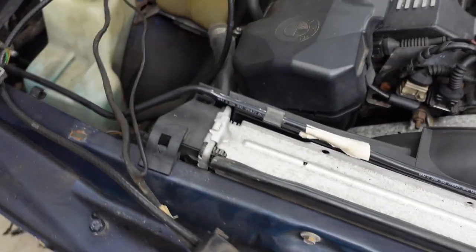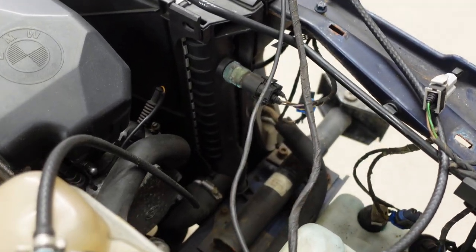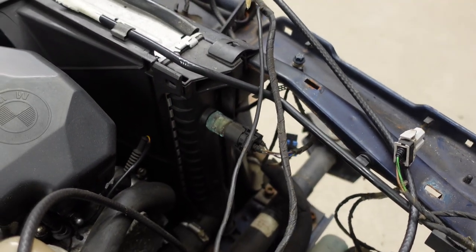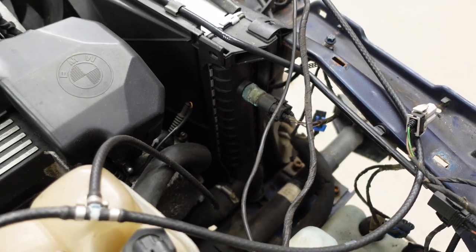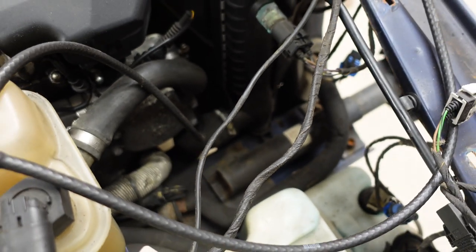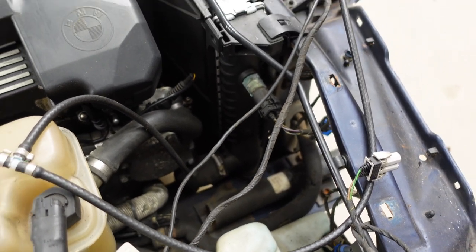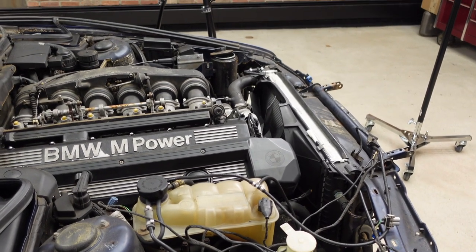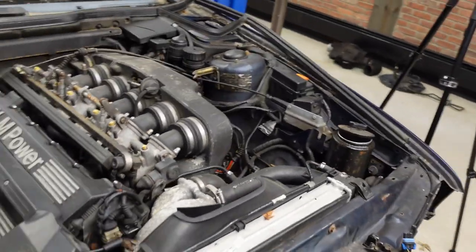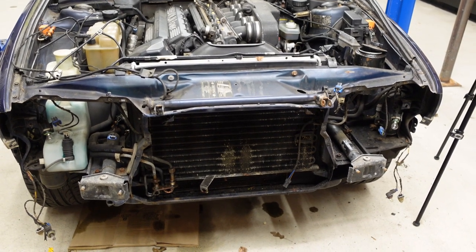Let's see from this side what's going on. This is the coolant temp sensor for the electric fan, so we just have to unplug that. Once we get that done, the radiator is held in by some rubber mounts on the bottom, and we have to undo that lower radiator hose, and it should all come off. Once that's out of the way, we should get a clearer shot of how the AC condenser is held in. We'll get that out and figure out how the sheet metal comes off — looks like a couple screws. Let's dive in.